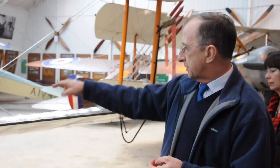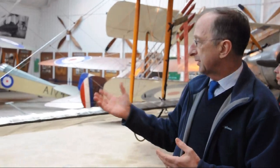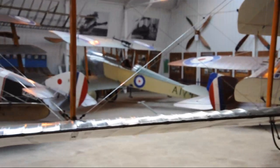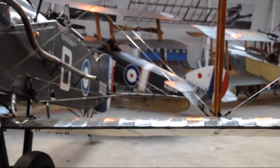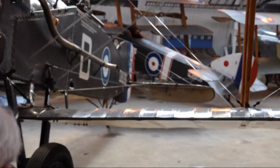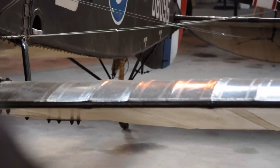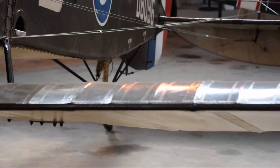If you notice the skid on this airplane, it's not under the rudder post like it is in most airplanes, so it doesn't steer with the rudder. Neither is it fixed — it's just got a bungee that holds it roughly in the middle. That is a really bad combination. Fixed skids are okay; skids that steer on the rudder bar are okay. But bungee-centred skids like this are a problem because the airplane on landing will go where it wants.